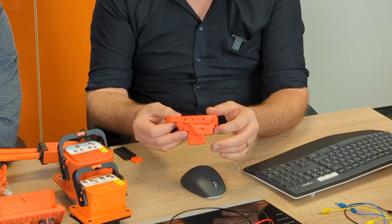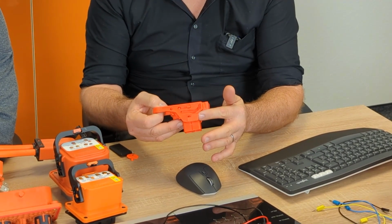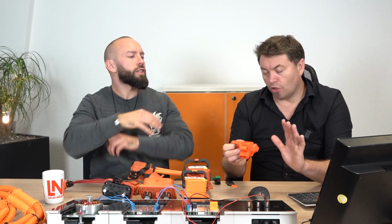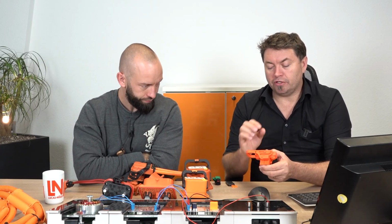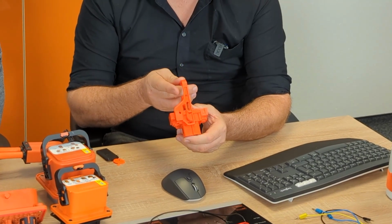Exactly, and it's part of the reason why you wear a face shield and full body protection when working with high voltage. But the first thing we do here is pull it out, which disconnects the interlock connection right here. And this is of course no problem, because we are just disconnecting like 5 or 12 volts. Well, it's actually 12 volts, but it's a constant current circuit. We'll have a look at that, it's a very interesting circuit. But it's low voltage, so nothing can happen. As soon as you pull that, the ECU can determine that the circuit has been opened, and it'll immediately open the relays.